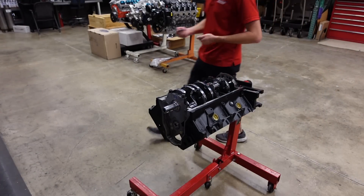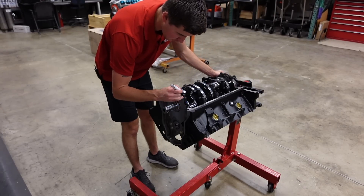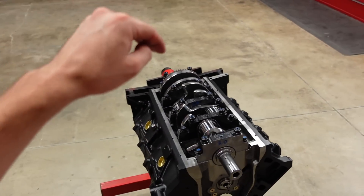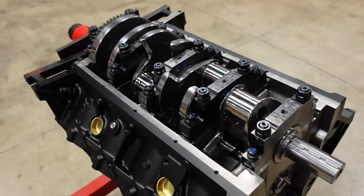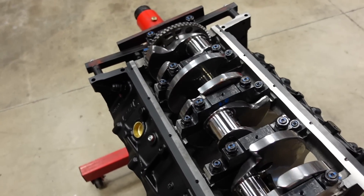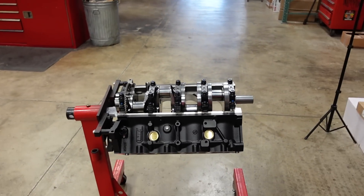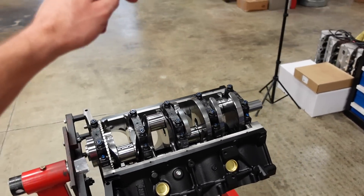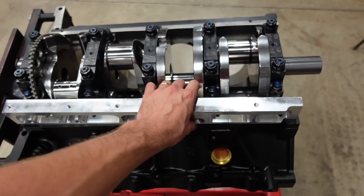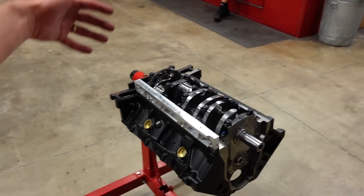Before we go any further, I always like to do a nice little blue paint mark on the bolts that I have torqued. The crankshaft is installed — the motor is finally actually coming together. It's not just parts on a shelf and a theory in the back of my head. I am freaking hyped up to see this crankshaft and this block finally. It just looks so freaking cool. Because this block doesn't have skirts on the side of it, we actually have some billet spacer skirts that are going to be installed onto the block next, and then I'm going to install the rear main cover.